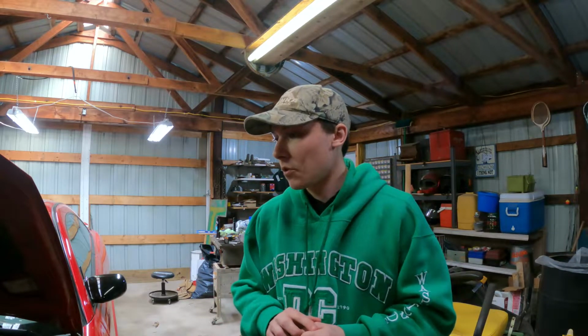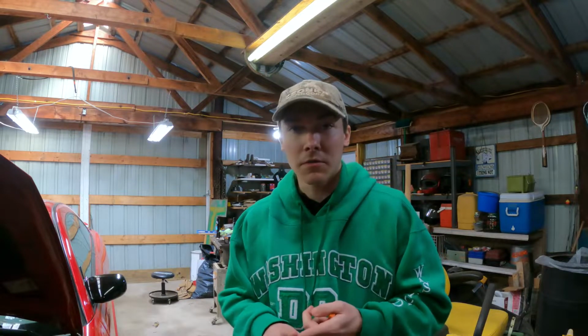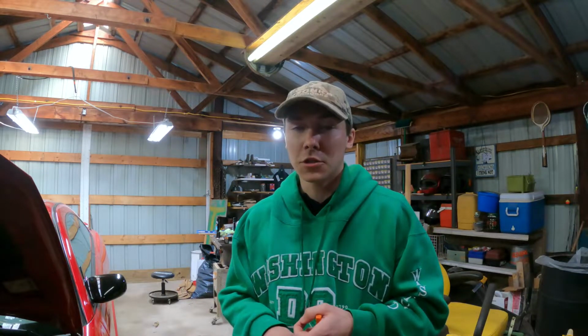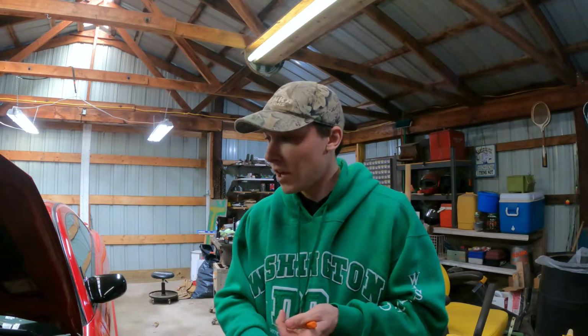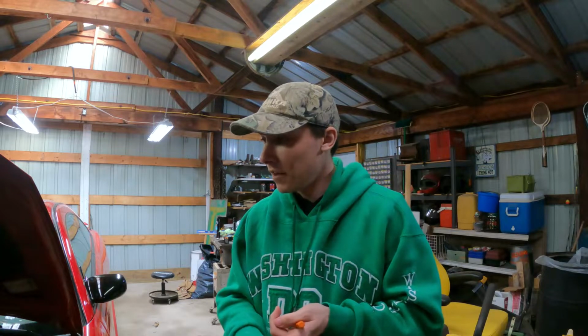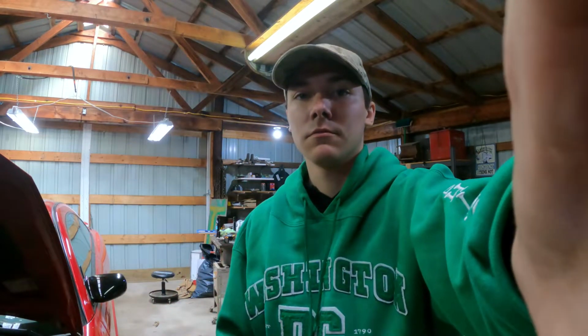Now, I pulled up a torque spec. It's about the same for everyone, which is 105 inch-pounds, if you're wondering. Also, it's about the same pattern for every valve cover, so I pretty much have that already. We're going to change the valve cover gasket and the spark plugs. I'm going to show you guys how to do that. Let me get my tools set up, and I will show you the tools. Give me a real quick minute, guys.